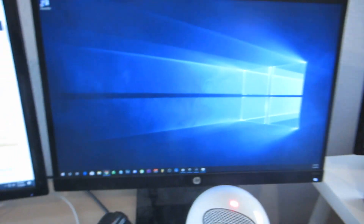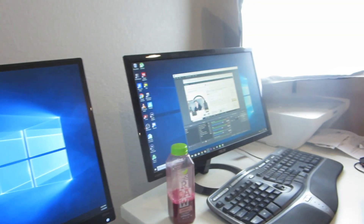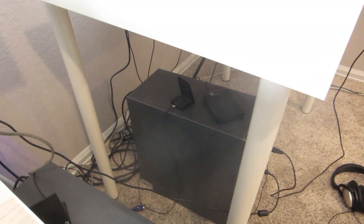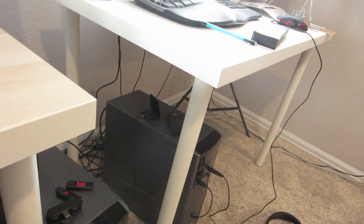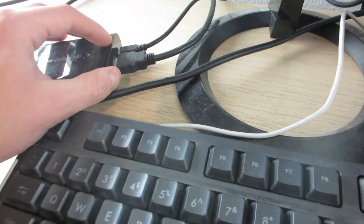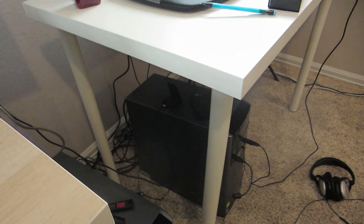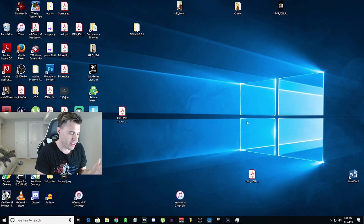This other monitor is just hooked up into my gaming computer via an HDMI port. The second computer is over here to the right — that's my streaming computer. They're side by side, pretty much. So the HDMI out goes into my main gaming monitor, and the USB cord plugs into your streaming PC. Now we have all the connections set up for the Elgato.